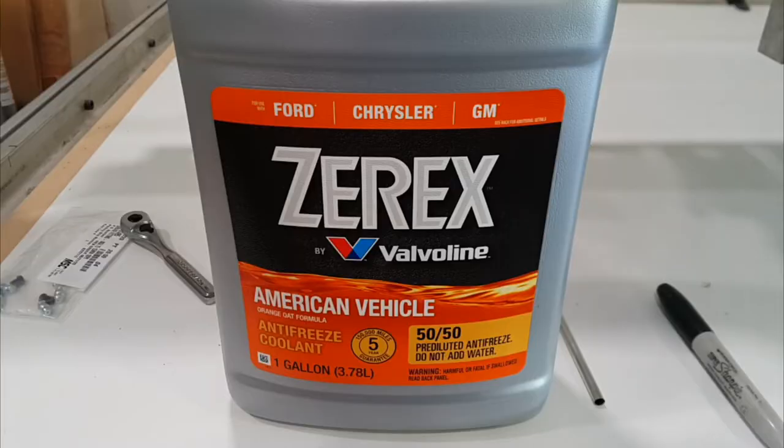Reading the back of these jugs is completely useless. Your best bet is to look at an SDS sheet to get a better sense of what's inside, but they still hide all their information. I think if you're actually trying to understand the chemistry, there's really no way to tell which product is best for this application. I'm going to start with the OAT stuff and see how it goes — it can react with tubing, brass fittings, aluminum fittings, some plastics — but at least now I have a window into the system, so I'll be able to see if something starts to go wrong.